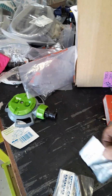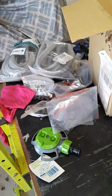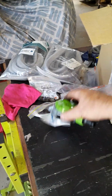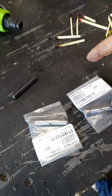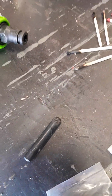And over here, I've got hinge pins, and I've got 3 hinge pins actually. I've got one oversized, one standard. There's one here that's oversized, so there it is. So that's the oversized one, and I've got 2 standards, just in case I need to do another one, and just because this could be oversized. So there's first oversized and second oversized. I'm going to try and put a standard pin in, because that's a recommendation. So I'm going to keep going here. Don't think this is going to be a quick job, because it just ain't.